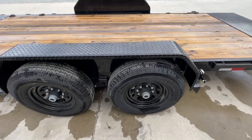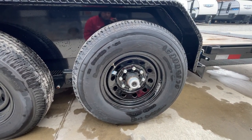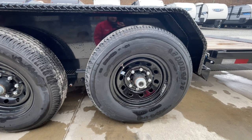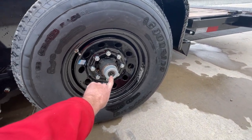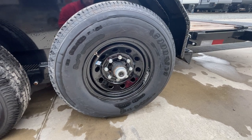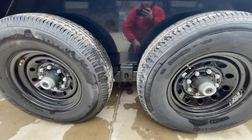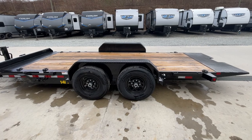We do have a double-broke fender standard, removable front and rear. You've got a 235/80 R16 10-ply load range E radial tire. It's got a Dexter brand axle with the newer-style never-adjust brakes — just like a car, it'll self-tension throughout the life of the pad, so very minimal maintenance is required. This also has the easy-lube hubs, so behind that cap you've got a grease zert. Clean the grease out, grease the zert, and when you see fresh grease come out, stop. It's fairly simple for a homeowner to do their own bearing maintenance. Between the tires, you've got slipper spring suspension, standard on most 14,000 pound trailers — a little heavier than your traditional eye-to-eye suspension.